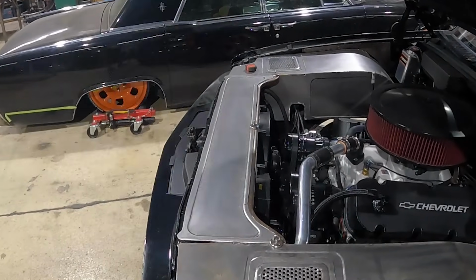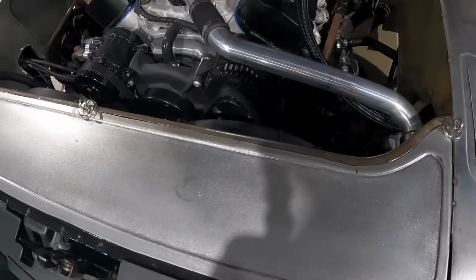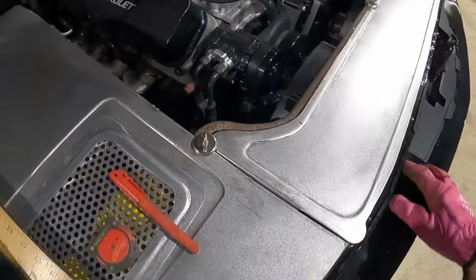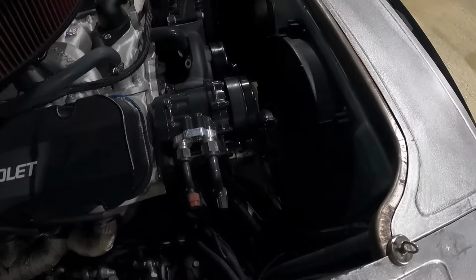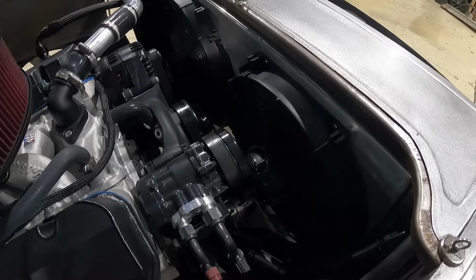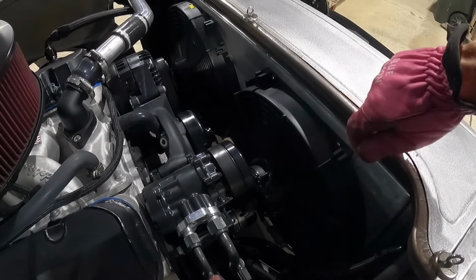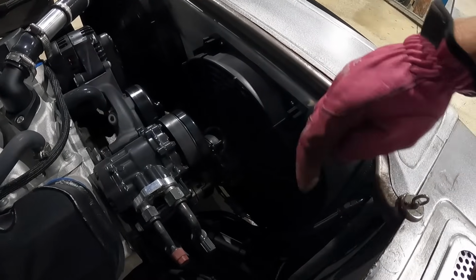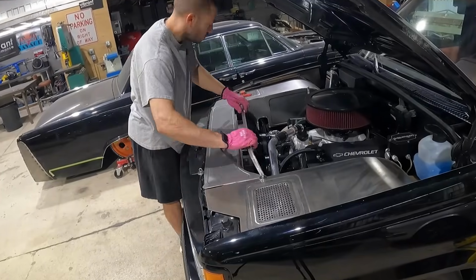Alright, here we got our flange made with the shrinker stretcher. It's fit up with these magnets, about ready to tack it up. Just gives it this nice rounded edge along the inside here. And I got one more piece to make to butt it up to this top edge of the fan shroud, and then some little curved filler pieces to help transition.